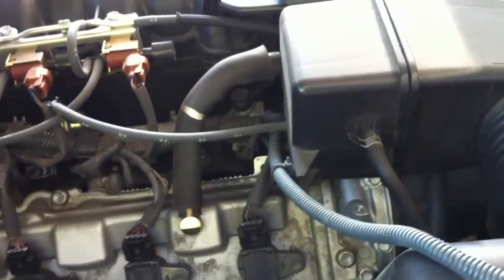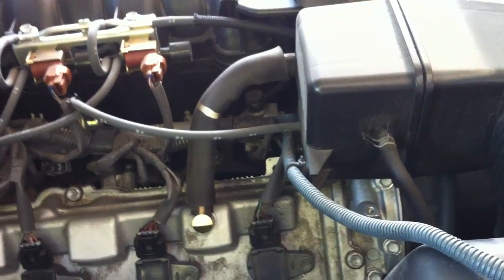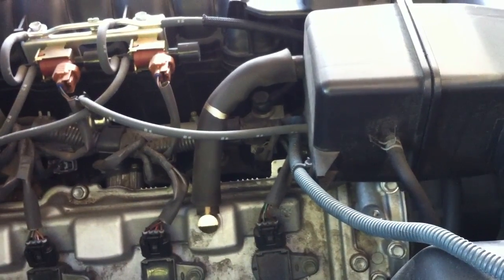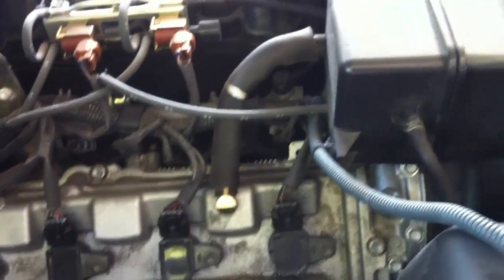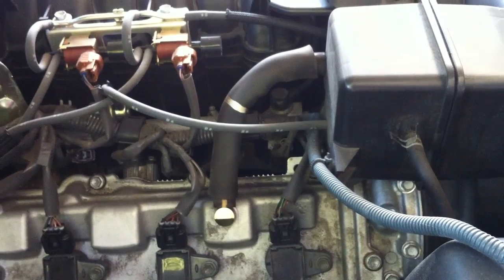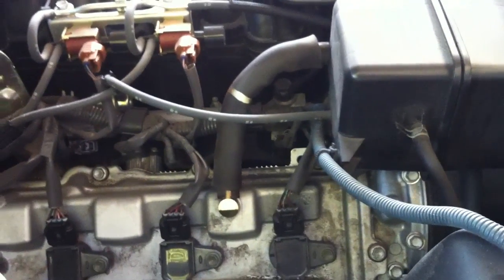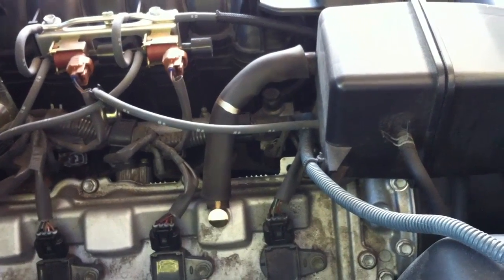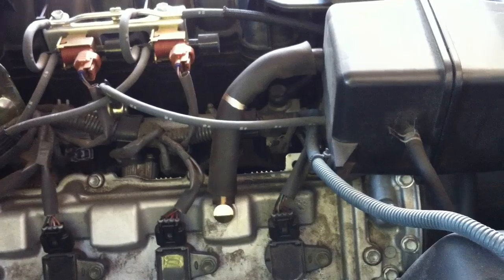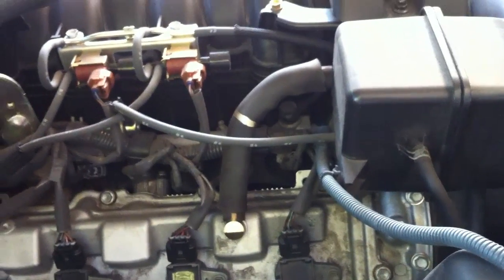This is just a valve that shuts off the exhaust to the catalytic converter — it shuts it off once the catalytic converter gets hot enough. So all it's doing is getting it hot sooner. It's not going to cause any performance problems. It will actually stop the performance problems you have when all the codes come on, because then the car just goes into limp mode and won't take off or anything.